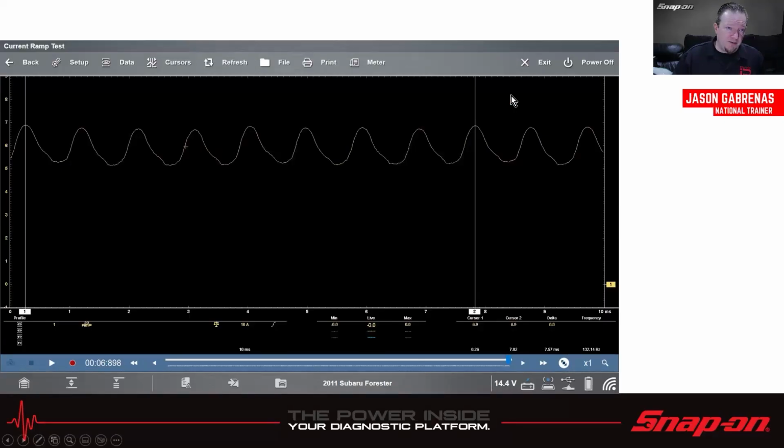If I get above 5,000 or 6,000, I know I'm in good shape. This one's actually a variable RPM pump too, but anything over 5,000 to 6,000 RPM is a good rule of thumb. It's where you want to be. Anything below around 3,000 RPM, you might start having drivability problems, especially under load, because that means the pump can't get the fuel to the front fast enough because it's not spinning fast enough to get it up there. Might get some cavitation or hesitation going up a hill or something like that.